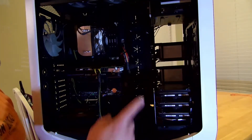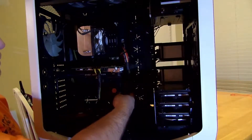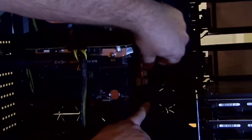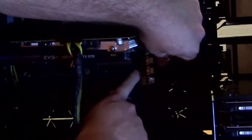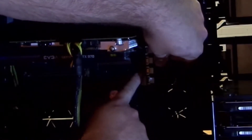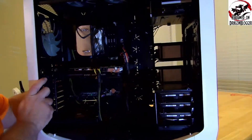Now I'm going to have to trace maybe one of these cables back to this puppy down here, so that I can — if you guys can see it here — this is the ASMedia controller, and this is the Intel Z87 controller. I want to plug it in here, but I'm all out of ports, so I'm going to have to move one of these guys down here. Let's find out which one goes to the optical, because the ASMedia only has one plugged in there, and I'm sure it's one of these opticals. Cables run back here, up here, and let's trace them.